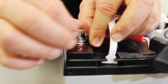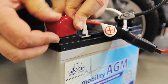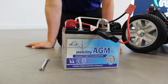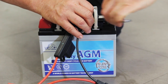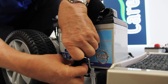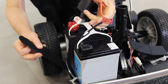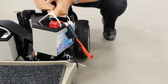Connect the ring to the terminal using the screw and tighten with a spanner to make sure it's fully secure. When in place, push down the rubber cable cover to protect the terminal. Repeat this process with the other cable on the second battery. Once you have connected the cables to the batteries, you are ready to place them onto the scooter. Remove the velcro straps, then carefully place the battery on the platform and secure it in place using the velcro strap. This will prevent the battery from moving around and becoming disconnected when driving the scooter over rough and rugged terrain. Remember to do this for both batteries.